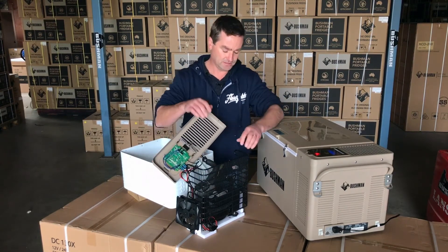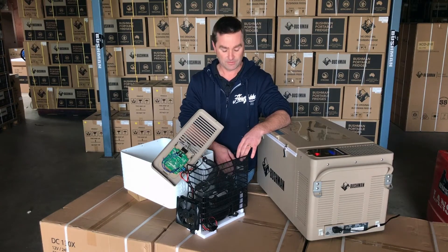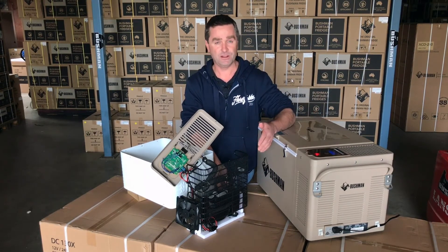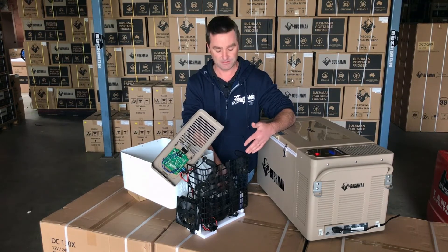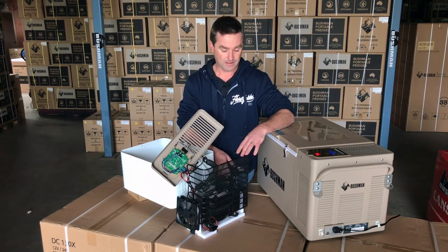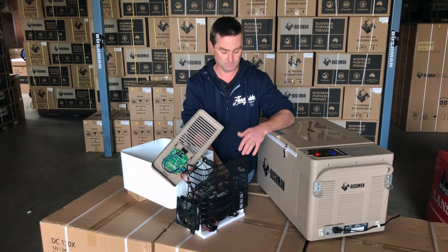The compressor is mounted to the bottom base plate through four rubber mounts to absorb shock while traveling. We've also got a diagnostic LED light — if you get a fault, that little light will let you know. You can see it through the top of your fridge; the number of flashes tells you what the fault is. Ninety percent of the time it's a voltage issue — wiring that's too small, a bit of corrosion between terminals, something simple like that. It's hidden down there so there aren't too many bells and whistles up top, but it's there so you can find out what's happening when the fridge isn't running.